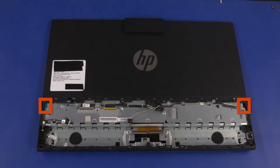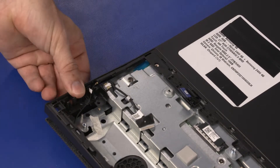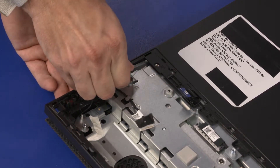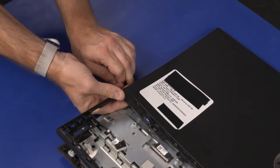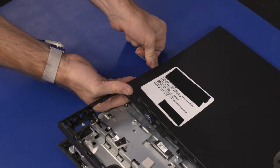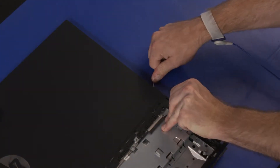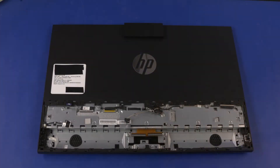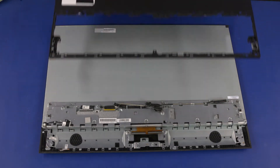Both the upper left and right edges of the back cover are held in place by strips of stretch-release tape. Each tape strip has a plastic pull tab attached to one end. Carefully flex the bottom edge of the rear cover and grasp the pull tab on one of the strips of tape and carefully pull it toward the bottom of the unit. If the stretch-release tape strips are pulled too quickly, they will break before releasing the rear cover. Repeat on the remaining strip of stretch-release tape. Carefully release the rest of the rear cover from the adhesive that secures it to the unit and remove.